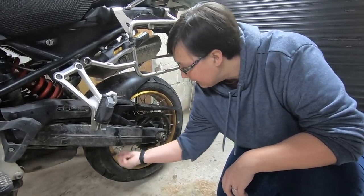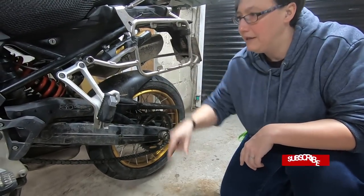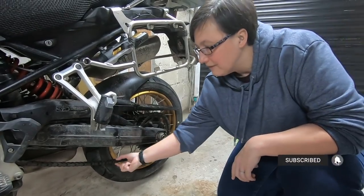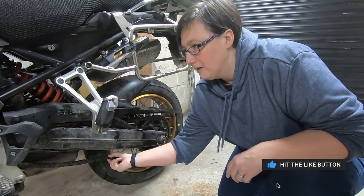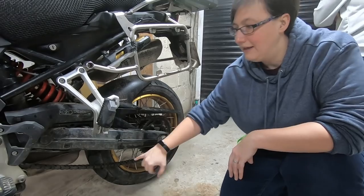As your drive is engaged and the chain is spinning, if you've got this extra slack, you've got the potential for it to jump off the sprocket and get wrapped up in the rear wheel, spinning you over the top — that's a disaster. The other watch out is to make sure it isn't too tight, because if it is, you're going to put too much strain on it and cause extra wear across your sprocket teeth and chain.